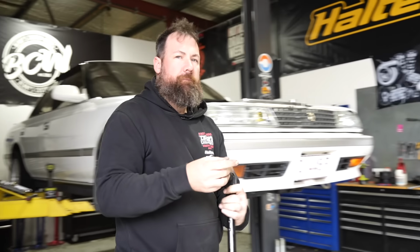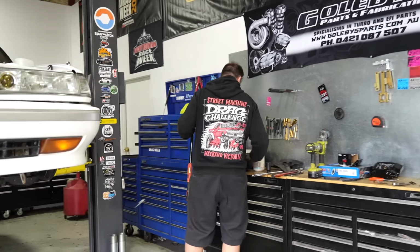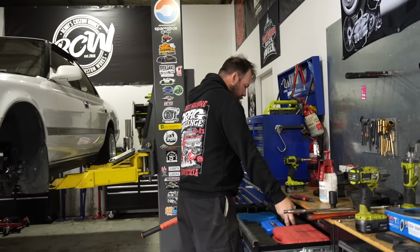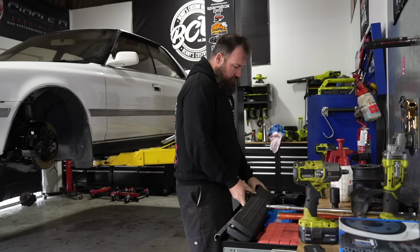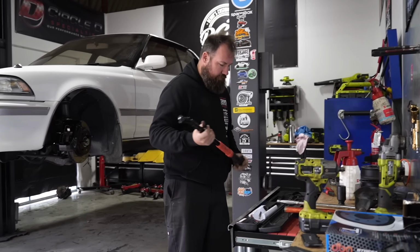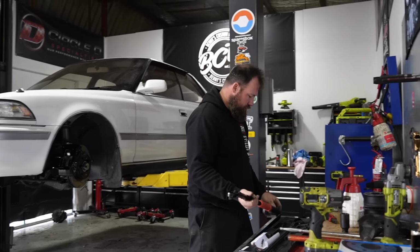So when you check it that second time, are you feeling that it's actually getting tighter? Typically no, but it's just making sure, because sometimes if something's excessively greased, it can actually move more. But because there's minimal grease in there on the thread, it's not a drama.